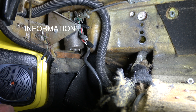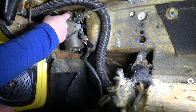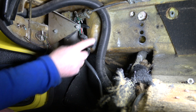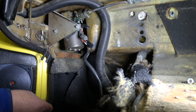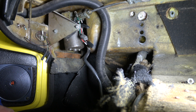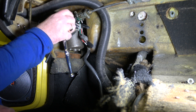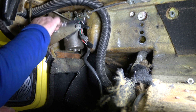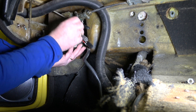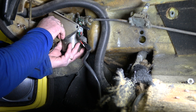Here we are inside the car. There's the wiper motor. There's a terminal lock that needs to be disconnected if you've already got any wiring and it's still installed. From the wiper motor we have the wheel box there, and there's another one there. There are two nuts attached to that bracket which is fiberglassed into the body of the car. It's a 7/16th socket that's needed to undo that, and it just drops out because we've removed the nuts from the outside of the car.